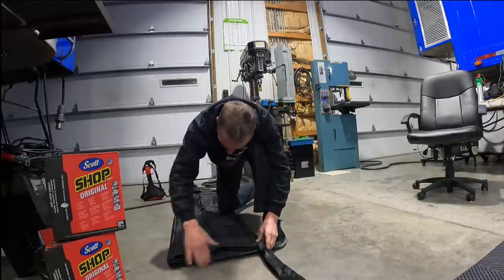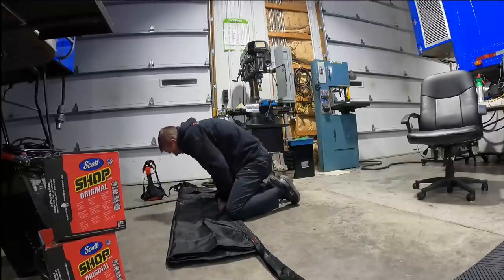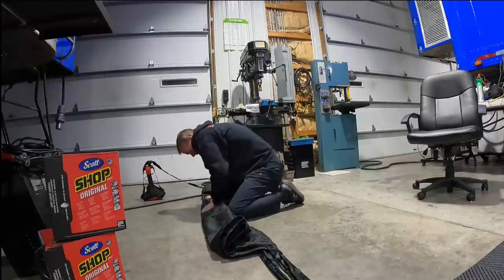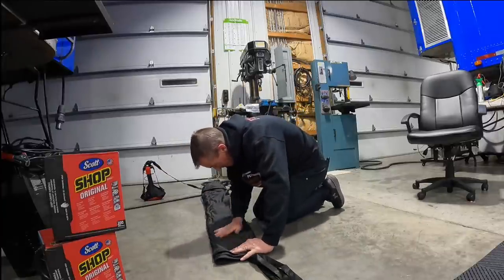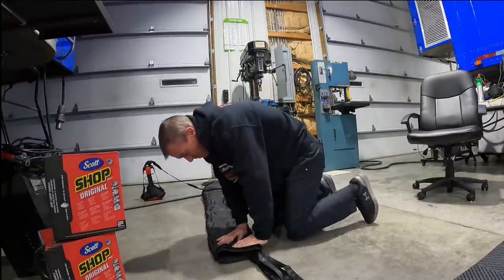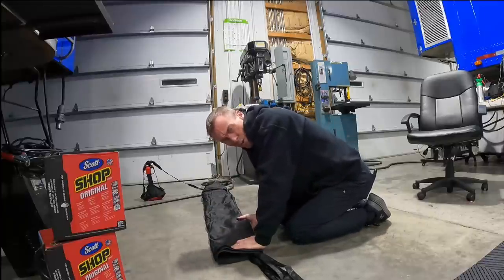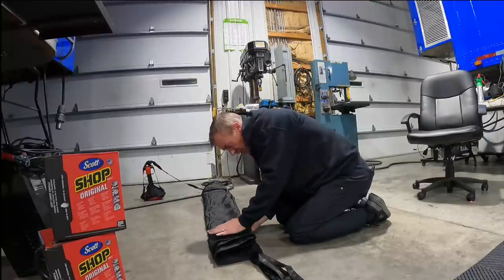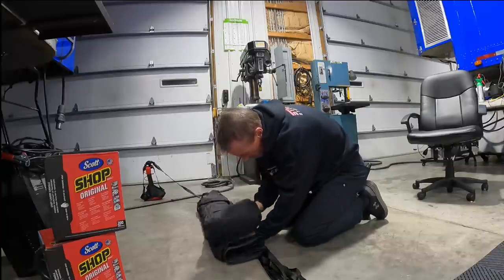Get this square right across here, put my knees back over, make sure it's lined up. Now I fold it in half. Brand new chute, it's definitely slippery. So now I've got it folded in half, I'll take my hand and push the air out of it. Then you come back here and start S-folding the parachute — kind of like folding laundry or folding towels. We know how big that box is, so you put one hand on top, one underneath, and pull it over.